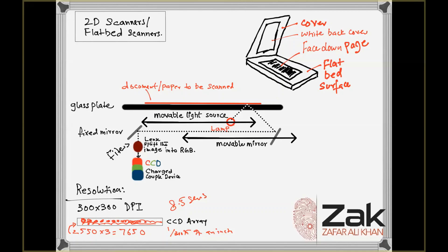For example, at 300 by 300 DPI scanning a letter-size document, the CCD has 2,550 sensors per row, and the scan head scans about three lines at once, giving around 7,650 sensors total. Sharpness depends mainly on the quality of the optics used for the lens and the brightness of the light source. A bright lamp and high-quality lens will create a much clearer and sharper image.